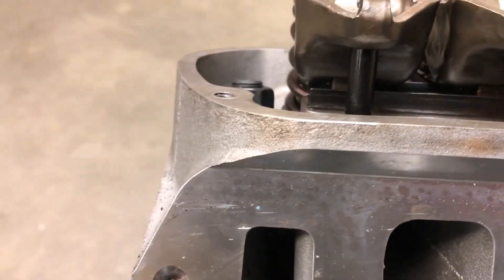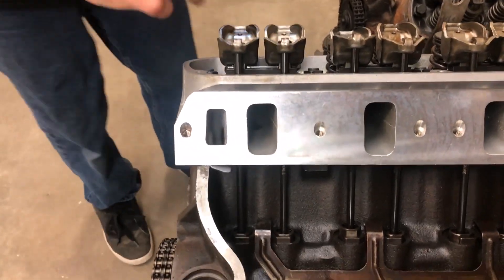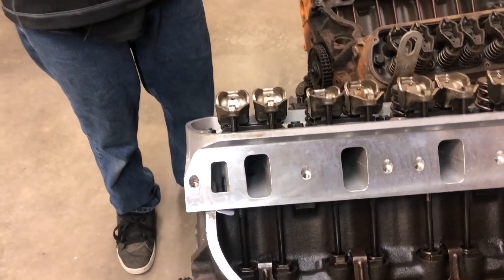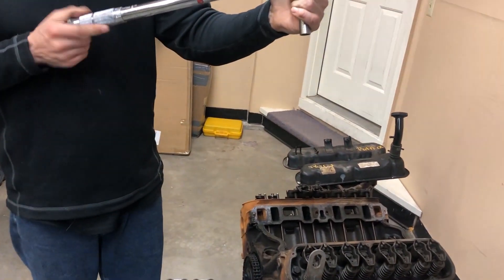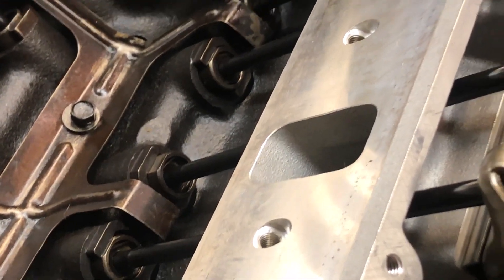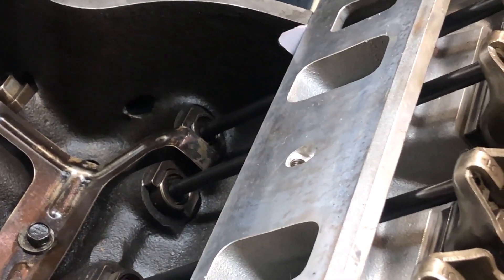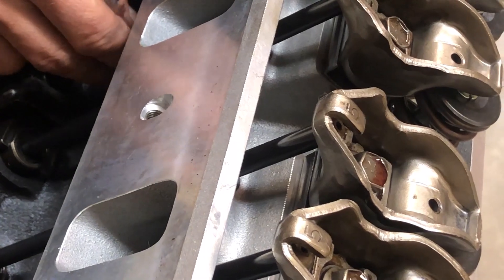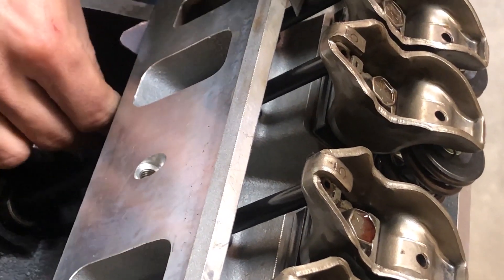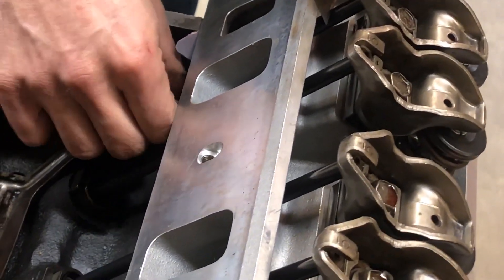At least I know what it is - it might not be right but I know it's not right. The rocker arm spec is actually 20 foot pounds - I was wrong when I said 25. But whether it's 20 or 25, it's going to stop at the same distance. The only risk you run is snapping your bolts or stripping the threads. Once it's bottomed out, it's bottomed out - any additional preload is completely dictated by the geometry of how this is bolted and the distance between these components.